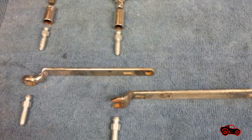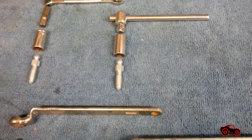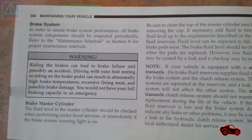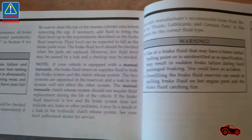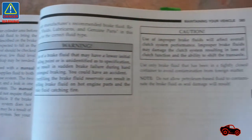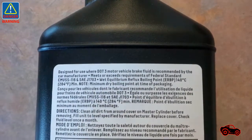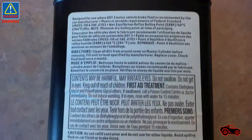To be well prepared, I made sure to have multiple 8 mm tools to undo the bleeder screws. I also had plenty of DOT 3 brake fluid. This fluid is dangerous, so it's important to follow the instructions written in the owner's manual and on the label of the brake fluid bottle.